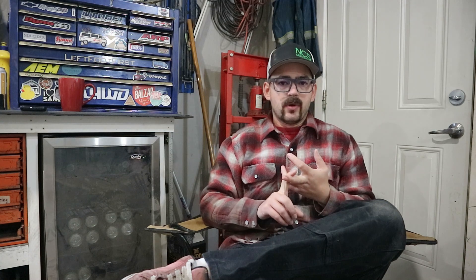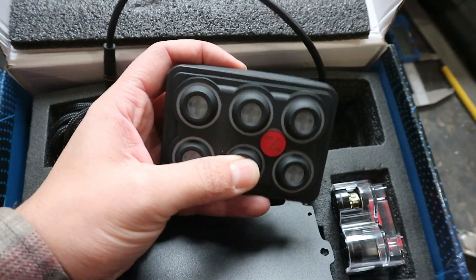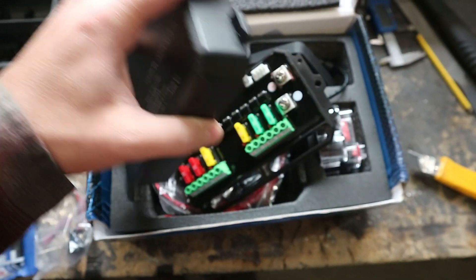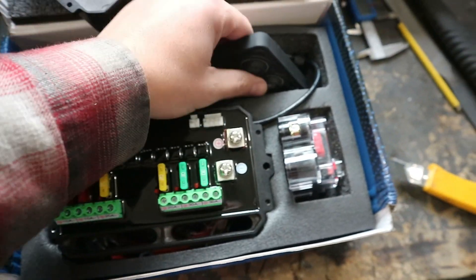We've also bought what's essentially a CAN keyboard — a simplified CAN bus keyboard. It goes in the car and connects via a four-wire plug to a control module box in the engine bay. That control box has solid-state relays in it. We're going to use the CAN keyboard to control things like headlights, blinkers, horn, and the starter. That should clean up a lot of the in-car wiring.